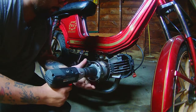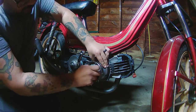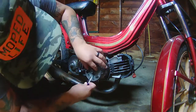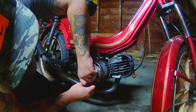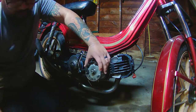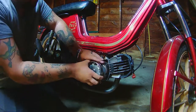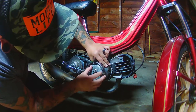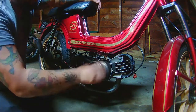That's gonna help me take the nut off of the actual crank arm. You can see I used an impact wrench to get that big nut off. You've got the little washer there, and on my moped the ramp plate moved a little bit — I guess it wore down a little bit — so here it got stuck. You can see the struggle trying to get it off.